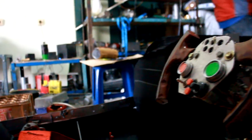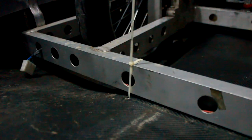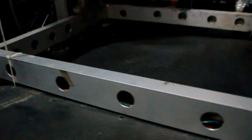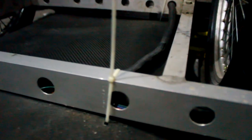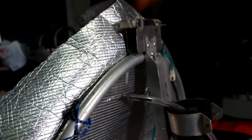The steering uses a steering wheel with a diameter of 25 cm. The vehicle's chassis uses aluminum 6063 profile, 50 mm x 25 mm, with a thickness of 1.5 mm for most of it and 3 mm for the rest. The roll bar type is pipe and it's merged with the vehicle chassis. We use aluminum as its material.